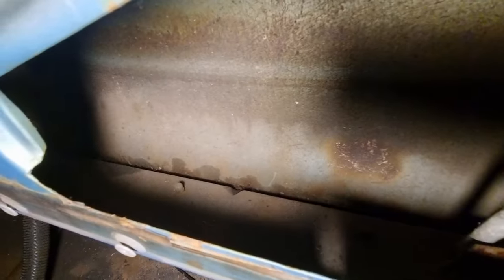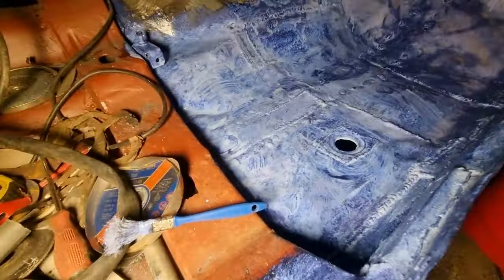Over there's done. Inside this door looks pretty good. I'll be back when I've Red Oxide Primed it. Just wanted to show you how I'll weld up pin holes - these are obviously the tech screw holes I made to hold the thing in. But I'll put a light on the inside of the car, then get the welder out and start welding wherever the light shows through. There's the post up there for the door with a little pin hole. That's how I'll find holes. There's none in the arch.